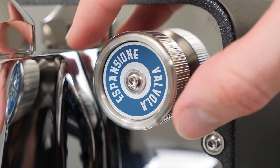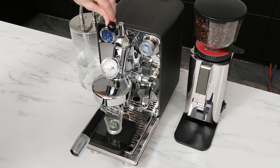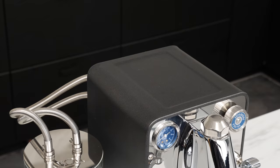I like pretty much everything about the Puristica. Some stuff is obvious: the small footprint, stylish design, simple internals, and control over a number of variables. But if you've ever owned an espresso machine before, you know that over time it can often be the small details that make or break your everyday user experience. First up is the portafilter. Aside from being angled for easier level tamping on a countertop, the spouts are centered directly on the portafilter head — this isn't the case with most manufacturers and even some other ECM models. Since this machine is so compact, you're naturally limited in your work area on the drip tray. The centered spouts allowed me to easily fit multiple espresso cups or center up a scale, whereas with offset spouts I would have had to hang the scale out over the front of the tray.